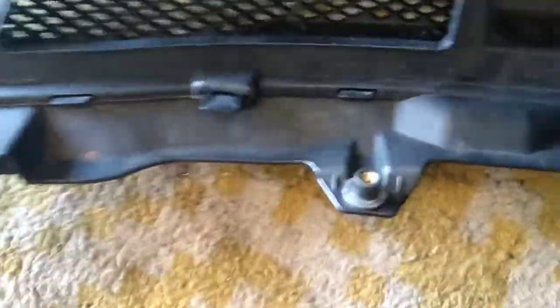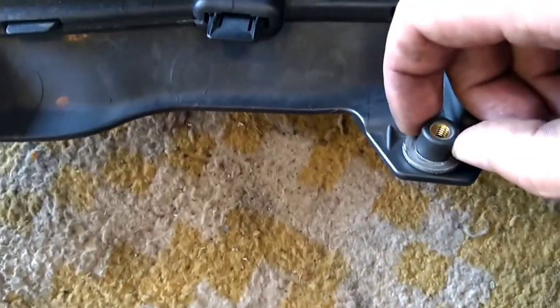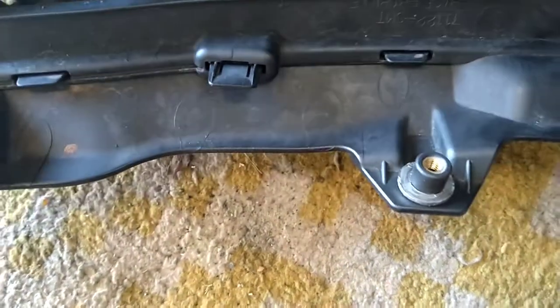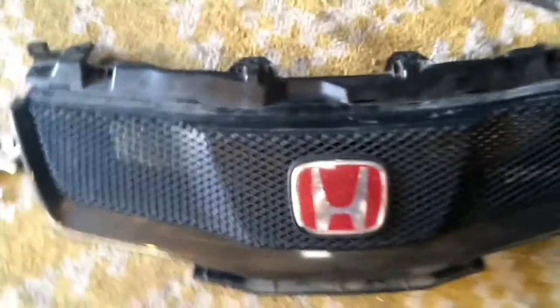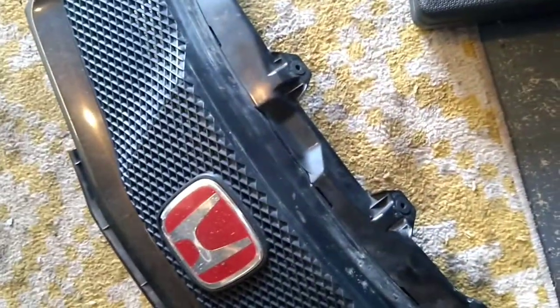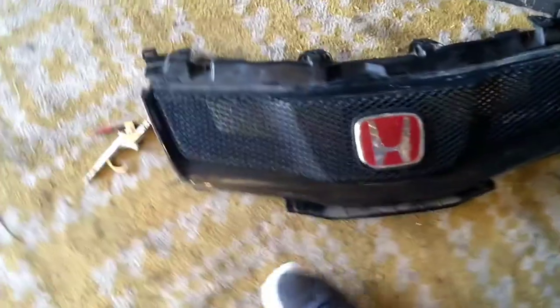I did fuck up one of them, and it pulled in a bit too far. So what we've done is used a washer there, and then once the rivnut closes up, it'll pull up tight. So that one should work fine. Just keep that in mind when you're doing it. I fucked it up, and it's easy done. And you'll fuck it up if you don't keep your eye on it.